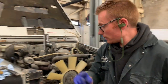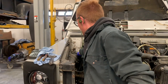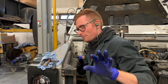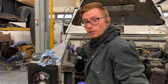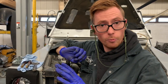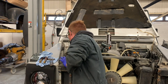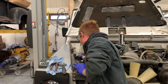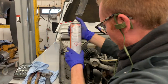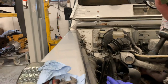That then gives you access for your alternator wiring, those little terminal posts. Now, another brilliant thing on these cars, those terminal posts always corrode, and what happens, you try and undo the nuts and it rips the whole pedestal out of there. So, in advance, just pop that little lid open, which allows you to get in there, give it a squirt with your best stuff, and then leave it.